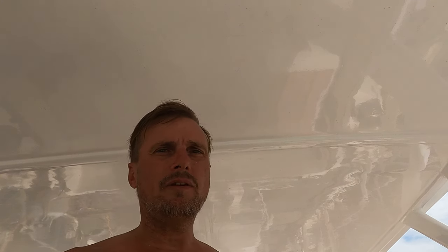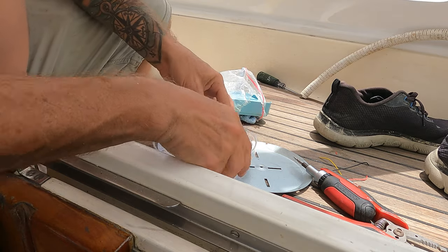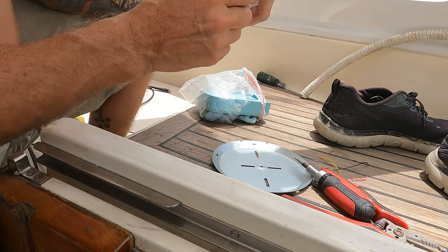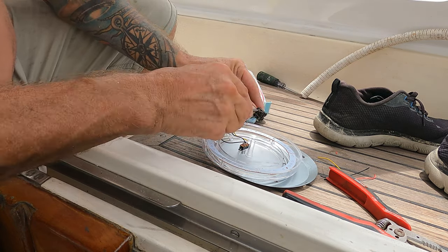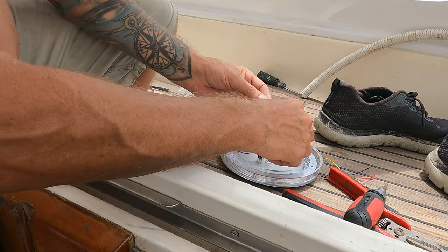Since I'm only doing this temporarily, I'm going to be using these little mechanical connectors. All you do is put the wire in and then tighten up a little screw. When we find some better lights we will be replacing them here in Trinidad. They're like $100 each and we need 15 for our boat plus the one out here, so we're going to source some from China. This fixture looks like it's for a 1970s car — it's got an extra ground wire for on, off, and door. The door does nothing unless I connect the two yellow and black wires together, then I can go on and on, and just off is in the middle. These little mechanical connectors are nice — they're so easy to use and you don't have to worry about wires pulling out because it's a screw holding it in, not just crimped together.